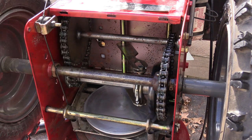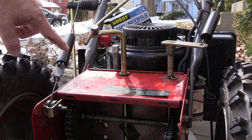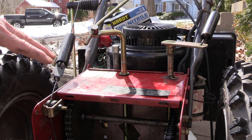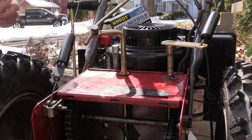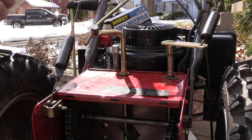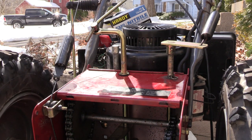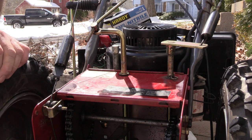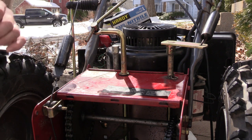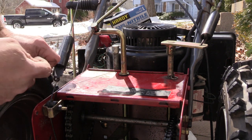I'm going to tension the cable a little bit to fix that issue. Actually, it doesn't use the cable — you have to remove the cotter pin and screw or unscrew this to give more or less movement. This bar needs to be able to push more this way. You don't want to do too much because you don't want first gear to sit dead center. Let's see where first gear lies — yeah, first gear is almost dead center, which can't be good. By having sixth gear go further over it'll also push first gear further over, which is what we want. I need to detach this to push it further.